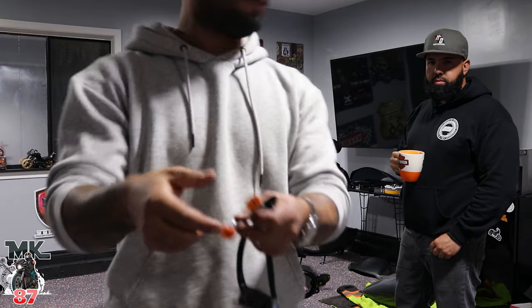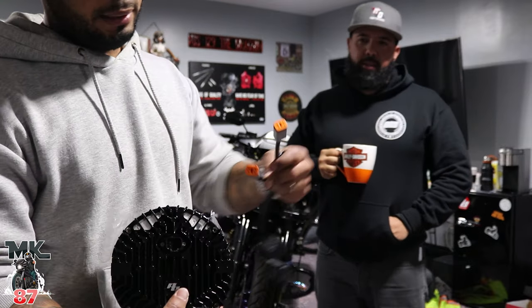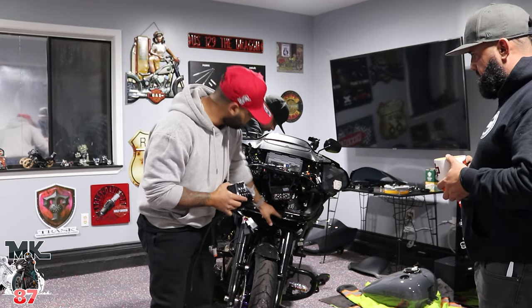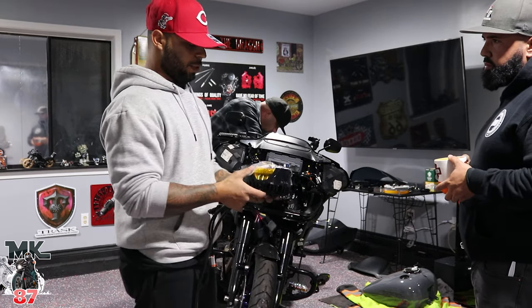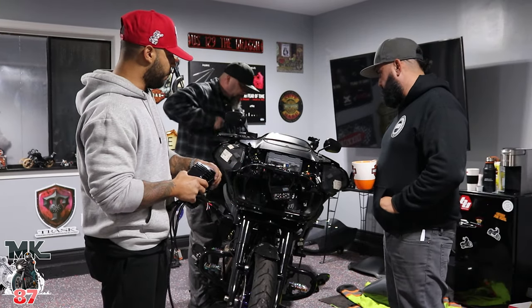The Baja lights are gonna have, can you pass your Baja light? He wanted to do one amber, one white. So right in the back right here, it gets plugged in. The bracket's like a T type of bracket. So bracket, two bolts on top, two bolts on the bottom. The lights go on the bracket and pretty much it. I mean, it's honestly not that difficult. It's just more annoying, taking everything apart.